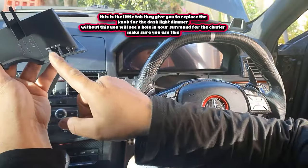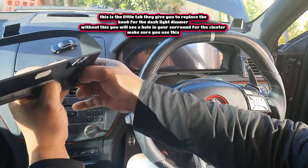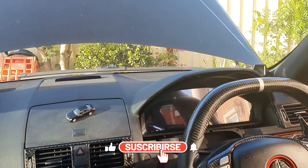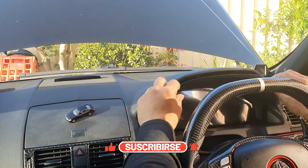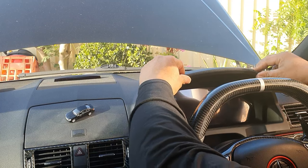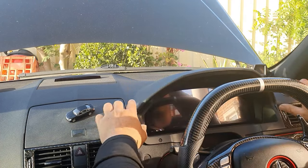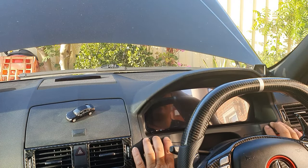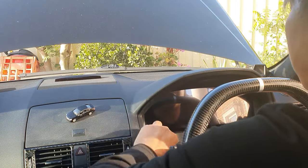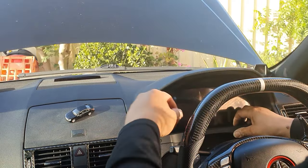There is a little black piece with three long tabs that you need to line up and slide over the top — it covers the hole. When putting the surround back on, get the flat part at the top in first. Once that's in, everything else will go in quite easily — just push it all in and it will clip in. After doing that, inspect the gap — it should be a millimetre or two and no larger. If it's larger than that, you haven't pushed it in properly.